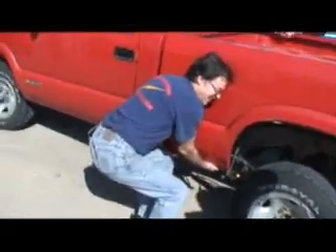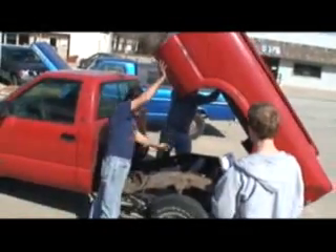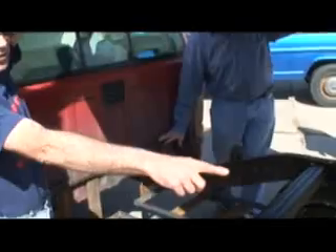To access the batteries, you lift up the front of the bed — it's hinged. Everything else is just bolts and you just had to put those hinges on. Take all the bolts out except the front ones right here — leave those tight — then you can just lift the bed up, slide the hinges under and weld. Leave those front bolts in for bed alignment, then when you're done take those bolts out. The hinges are tight so it lines up properly when you put it back down. I use my knee to push it up.